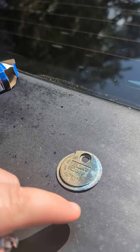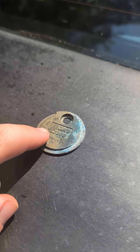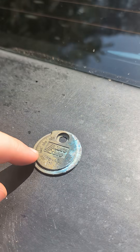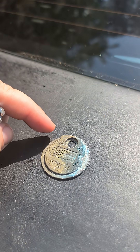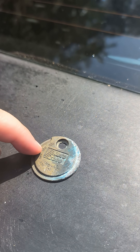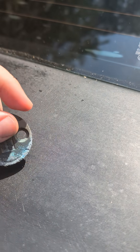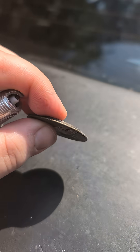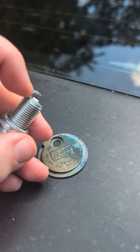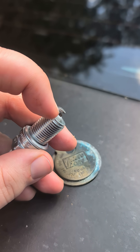I do recommend that you get yourself a spark plug gap tool. This one is so old it was actually a copper version — you can see where it started to turn green like an old penny. Your manufacturer of your car vehicle will say exactly what the spark plug gap needs to be. All you do is take this tool, and you can see it's got a tapered edge, and you slide it into this gap. That is how you can create more or less gap.